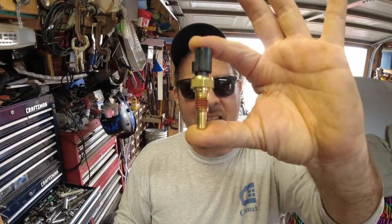The part I got yesterday ended up being the wrong part, so I finally got the right one. I did get the sensor out of there and I did not lose any antifreeze — for some reason nothing came out of that hole. I'm not sure if it doesn't sit in a coolant passage or what. Whatever the case, this new sensor has got to get put back in there.